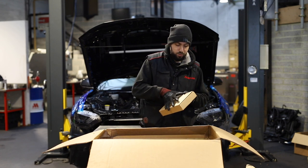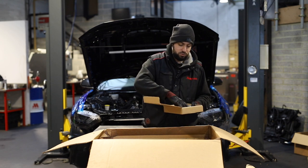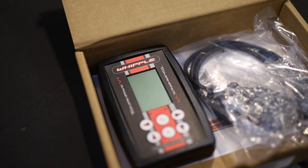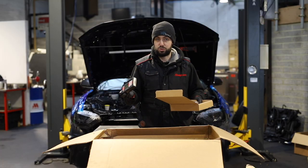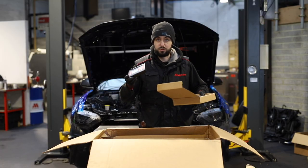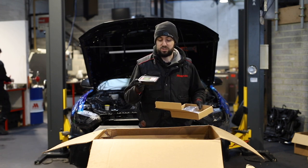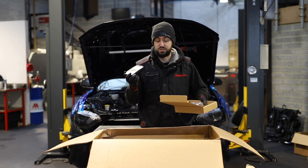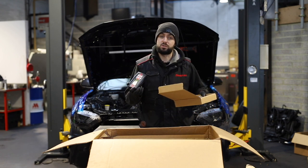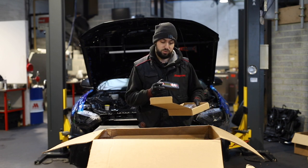This is the Whipple Tomahawk tool. This is what you use to send the files off to Whipple and flash them back onto the car. Obviously once you've fitted a supercharger, if you're doing it at home, you're going to need some form of tune to get you on the road. This is actually a finished file by Whipple, so you can leave this on as-is as long as your car's standard. This one however has long tube headers, so it is going to require a full tune by us anyway, but we do start with a Whipple tune.